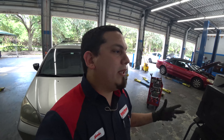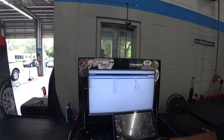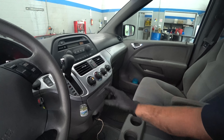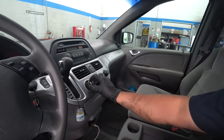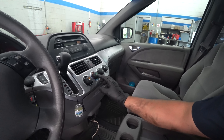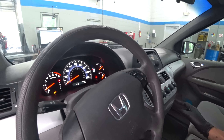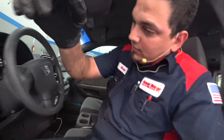It should be pretty simple — we're going to make sure everything's good on the electrical side. I did get a head start by setting up my AllData home page for service information. Knowing this system really helps. It is a relayed compressor circuit, there is a relay in the middle, and my AC light is on steady. Nothing happens when I turn on the AC.